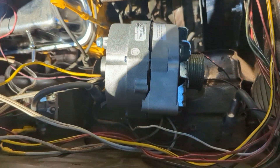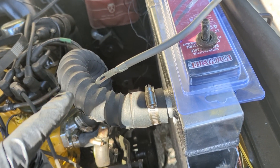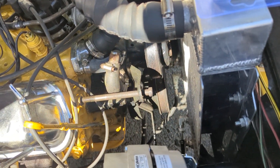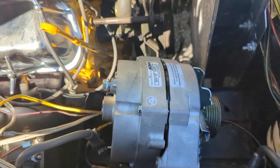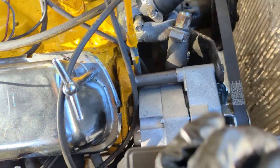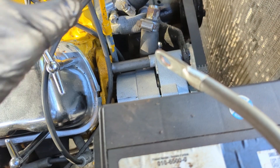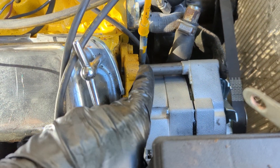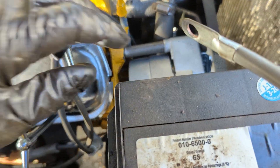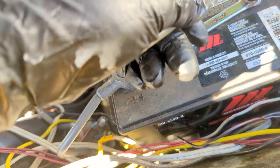It's the next day, a little bit windy. Let's see if this alternator will fit. I've got a couple of grounding straps - we'll tie one to the battery and the other to the chassis somewhere. I've made a spacer to go in between, so hopefully I measured right. Well, here's my alternator installed. There's my spacer - that worked out pretty good. There were a couple of interference items. This is a GM alternator, so I had to push the oil dipstick tube on this side of the bolt. I got my belt on, my grounding strap on the bottom pole down to the chassis, and my other strap to the positive of the battery. I just got to hook this onto the red pole - except I need a nut for this.